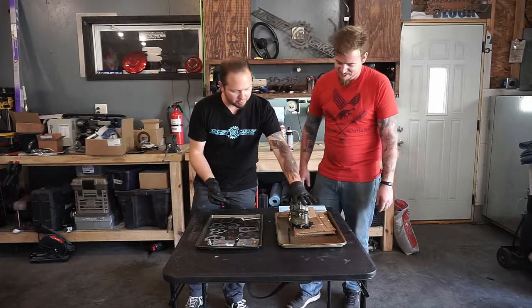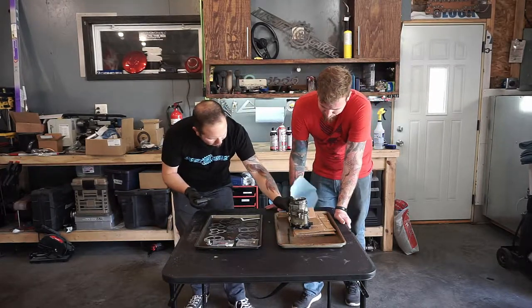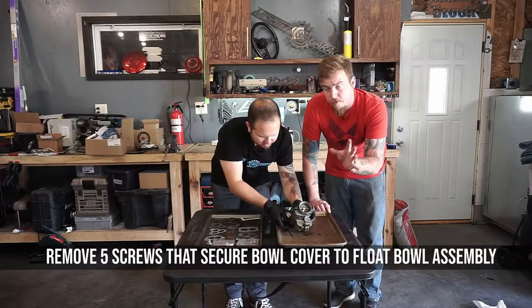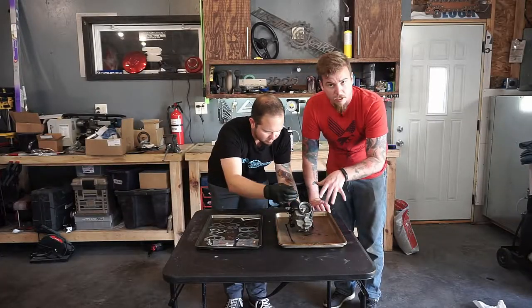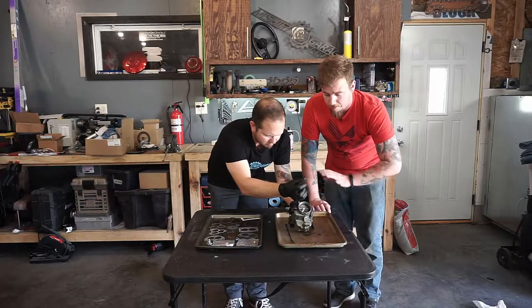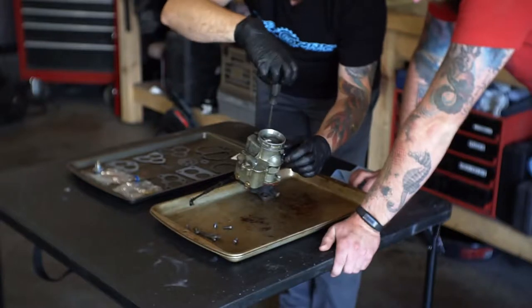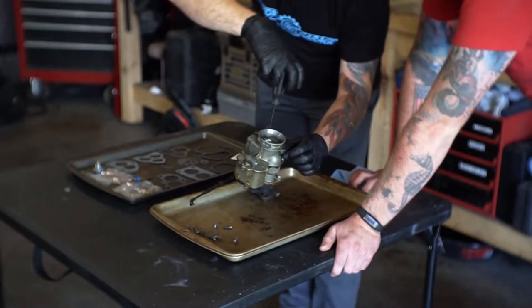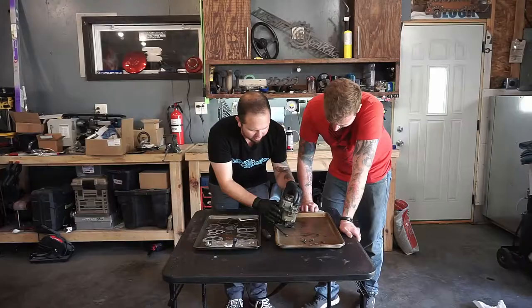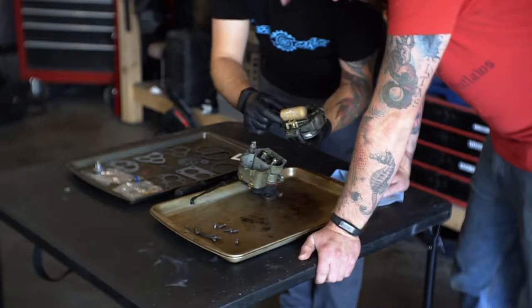So we'll start with the side that attaches to the oil bath. Pop that apart first. If you're doing this at home, don't be afraid to take pictures. There are so many little pieces and alignments and adjustments. Photo everything so that you have reference pictures when you're reassembling. It definitely helps that somebody's torn this apart before. Nothing seems to be stuck, which is nice. Okay. Something like that. Yeah, there's our float.